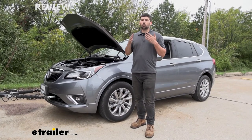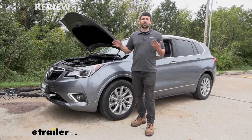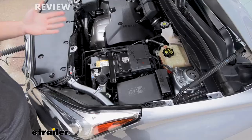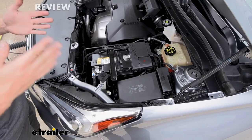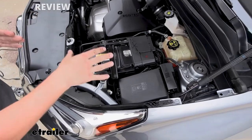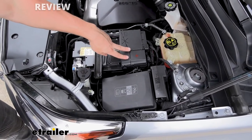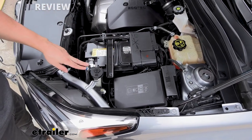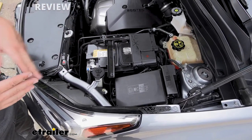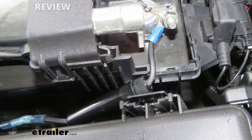Therefore, we're going to need to pull power for our braking system directly from the battery, and this outlet kit allows us to do that. It's a pretty simple kit — very easy to hook up and maintain. We're going to have two wires coming from the outlet kit that we need to run into the engine bay: one going to the positive battery terminal and one to the negative. There's also built-in protection with an inline fuse holder on the wire coming from the positive terminal.